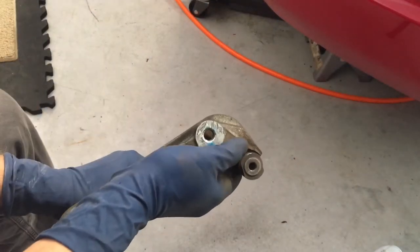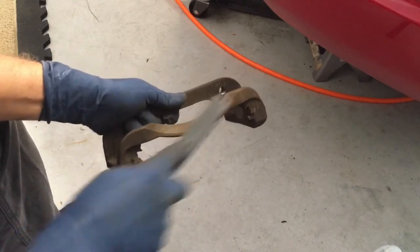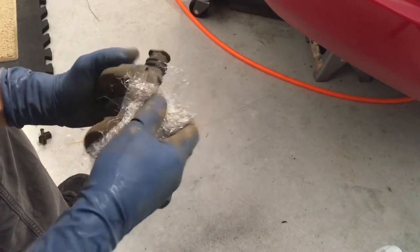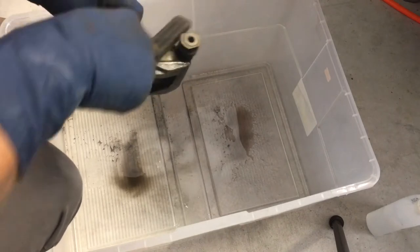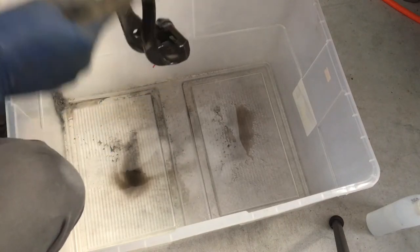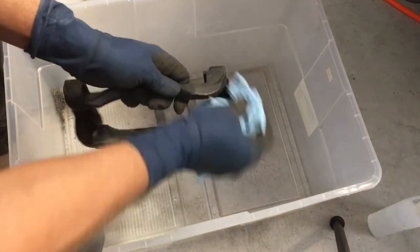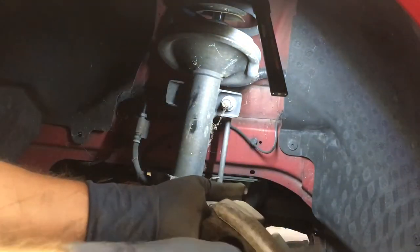Once the caliper is ready, you can start on the caliper mounting bracket. First, remove the brake hardware — my bracket has four small clips but some have two large ones instead. Start again with the brass brush, then move on to the steel wool. If it's not completely cleaned, the primer and the paint won't adhere properly. Give the parts a good spray down with brake parts cleaner. Be responsible and make sure you have a collection container for the cleaner. Keep repeating this process until it's completely clean, and you'll know when it's ready when the parts have more of a silver finish. Repeat these same cleaning steps with the caliper as well.